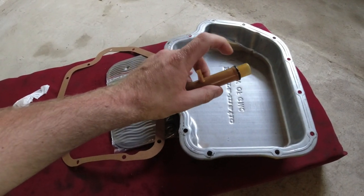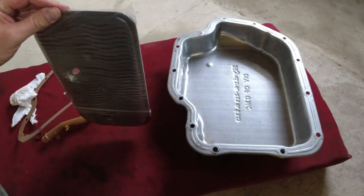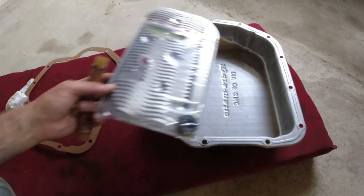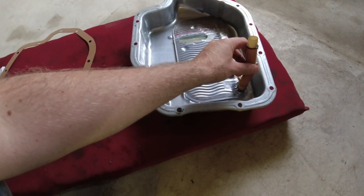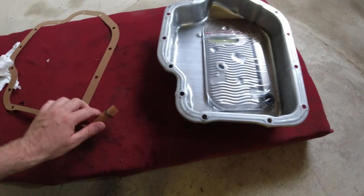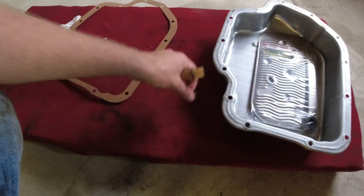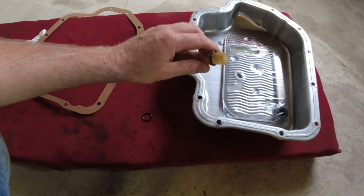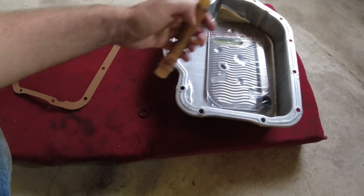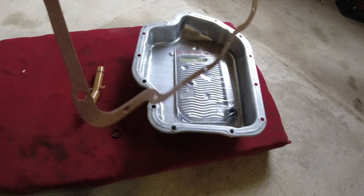This was the culprit — or at least I think so. That little O-ring there — this side sits up into the valve body. It's a plastic case. Here is the new filter: the filter lays in the pan and goes up there, so it sucks fluid through there, goes through the filter and up through the pickup tube. The old O-ring up there was, I think, faulty. I found a new one — I couldn't get the exact part, but I have a kit with a bunch of different O-rings meant to withstand oil and high temperatures, and this one seems to be pretty much exactly the same size.